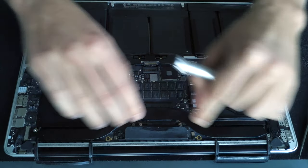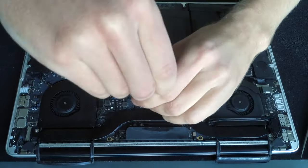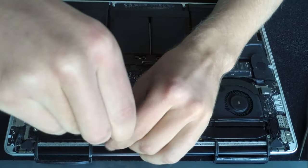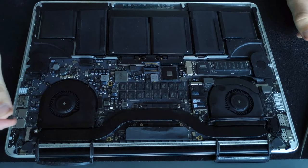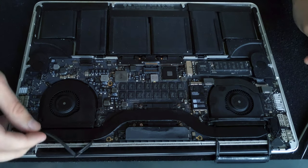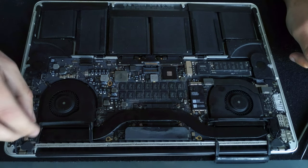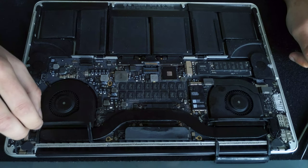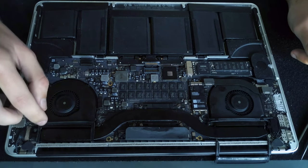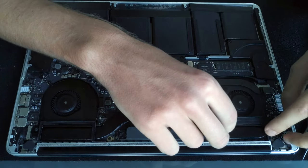Wiggle a little bit more and then screw all the screws pretty tight so there's really no gap. Tighten the screws to the point where you can't really tighten them any more — that's exactly the point you want to get to. Put back the little plastic cap on the left screw, then put back the rubber pieces that seal the fans. There are arms that go underneath the fan.